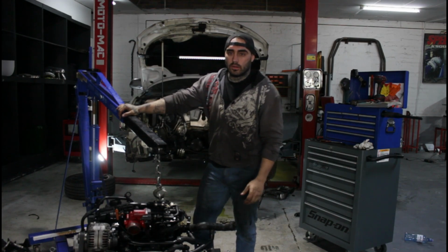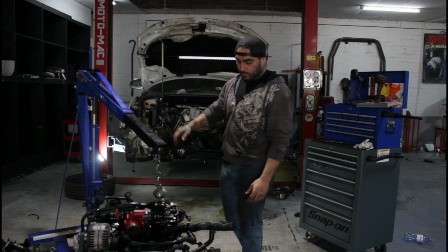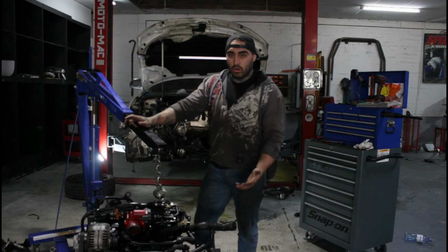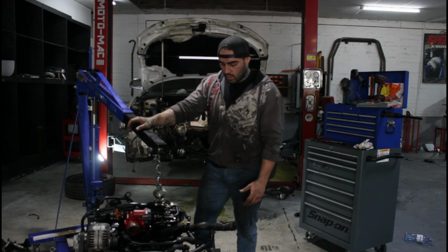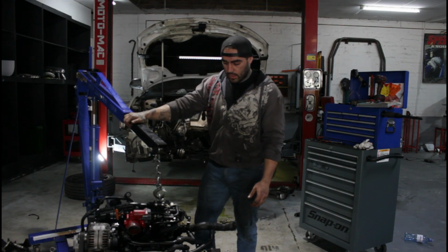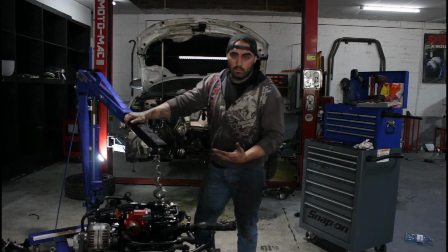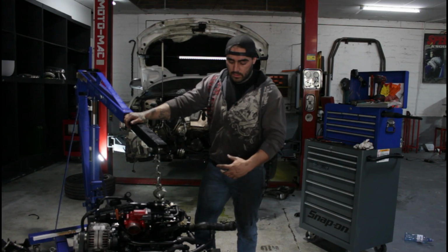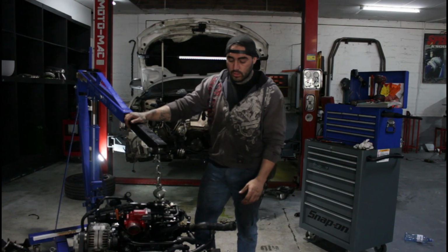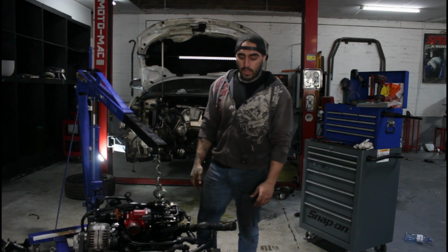Right guys, so the TFSI is out. So this is a manual car. The A3 that comes with the R32 engine, and the majority of the R32 Golfs, are DSG or automatic. So we will be looking at keeping it manual, checking maybe flywheel adapters, spacers, adapter plate for the box, whatever we're going to do. We're going to get to that as soon as we have the R32 engine or R36. I'd much prefer the R36, but whatever we can get our hands on.